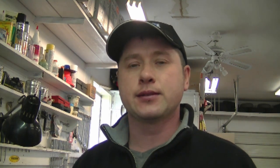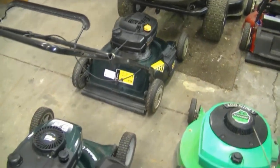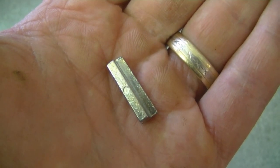A question I get a lot is why does the engine kick back or the pull cord rips right out of my hand when I go to start my lawn mower. That's because the flywheel key is sheared, which throws the ignition timing off - when you go to start it, it just backfires or kicks. Nine out of ten times I get that problem on a lawn mower with a Tecumseh engine - I've replaced dozens of flywheel keys on those engines. You might see it on a Briggs & Stratton engine but not as often. The flywheel key only costs a couple bucks, and if you can do it yourself you'll save a lot of money. I have an older video showing how to do this repair and I'll put the link in the description of today's Q&A.